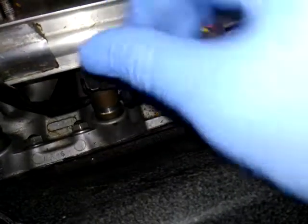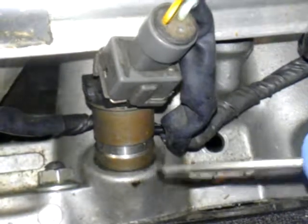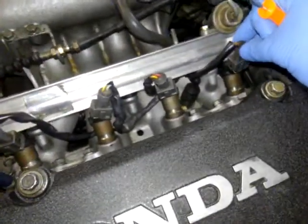If you notice these clips here, they have like these little wires. What I use to get those out is from Harbor Freight — they sell this cheap little pick set, Pittsburgh tools. Basically what I do, let me get the camera in there — I just get the pick, get it right there on the edge, pop it to the side, and it comes off. When you go back you just pop it back on, pretty simple.